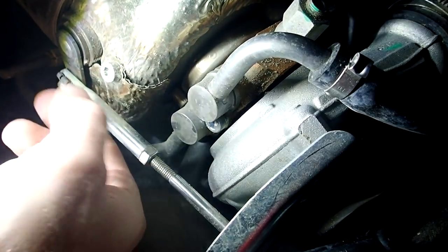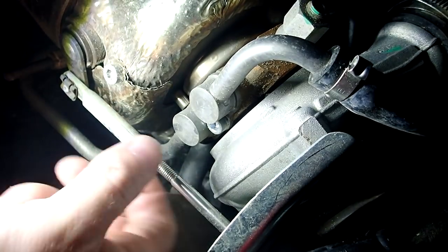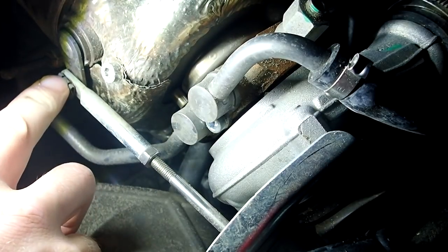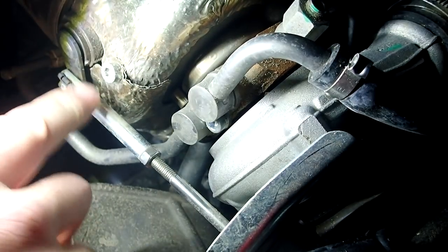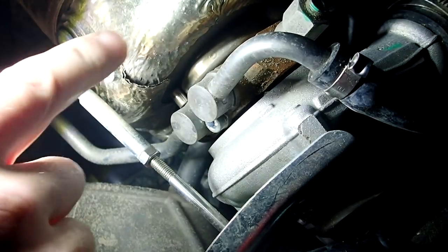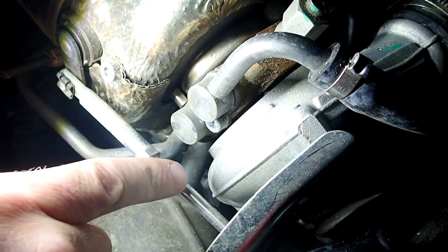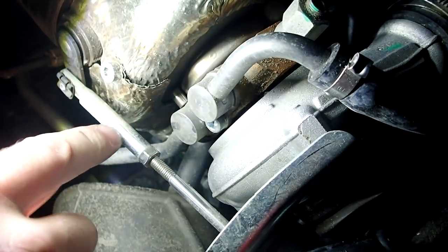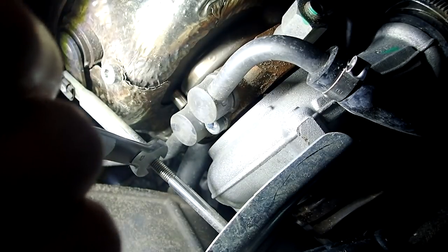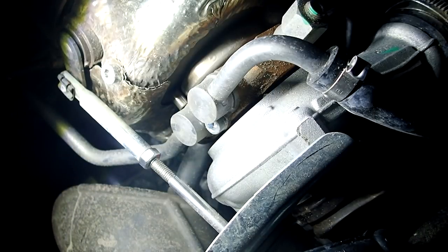To adjust that, we have to release this little clip — don't lose it. First we'll loosen this jam nut, then loosen up this clip, and once it's off, the instructions say to tighten it 2.5 turns. 2.5 turns should give us 7 psi, which means it should take 7 psi to open that. To get that jam nut, we're going to need a 10 millimeter — just to get it loose, and then you can spin it up.